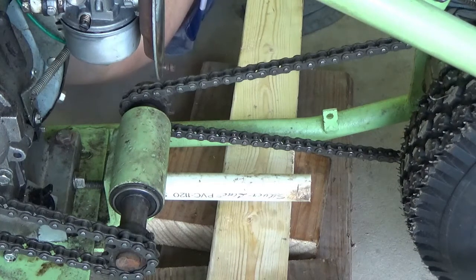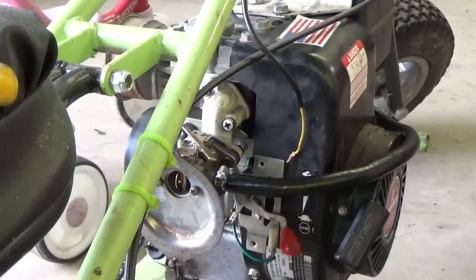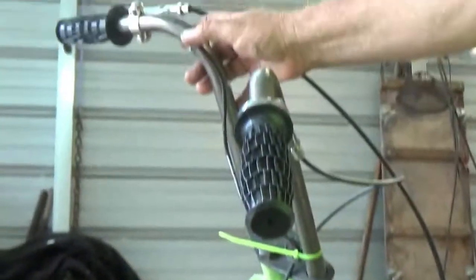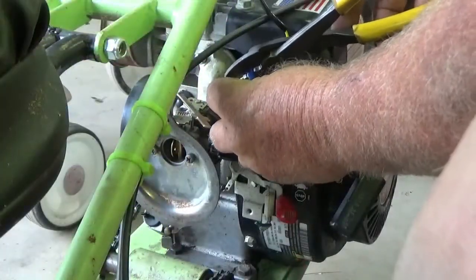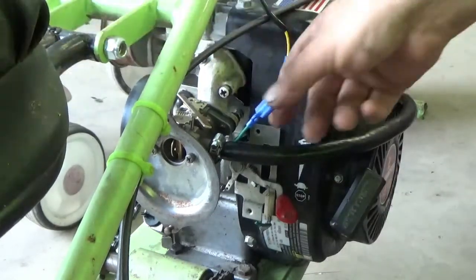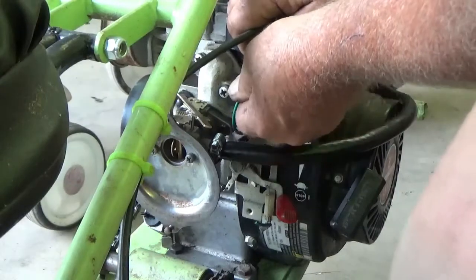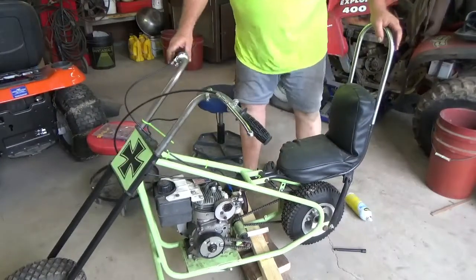What we're gonna take care of now is a kill switch. I'm gonna have it up here with this little red push button — that's gonna be the kill switch. Slide it in, make sure it goes, and crimp. Right there we go. We now have a kill wire. Our major project is gonna be trying to figure out how I'm going to hook up the throttle. We just hooked the kill switch up, got it all mounted up. Let's see how we do.